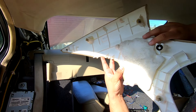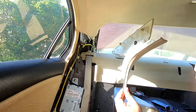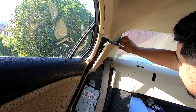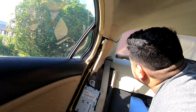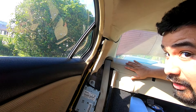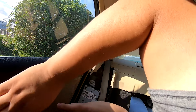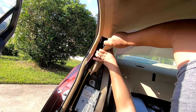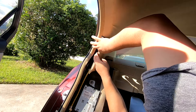Make sure you have all your clips in place before you attempt to put the C-pillar back, otherwise you'll have a poor time. To reinstall: slide the bottom in so the bottom hooks onto both sides, then come to the top, start clipping in your clips, then the big one — sneak it into its spot and collapse it. Now it's in there tight, it won't come out, and you can put the weather stripping back.